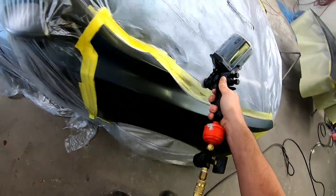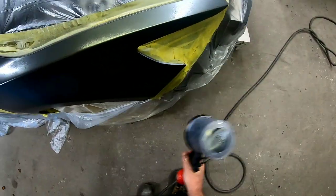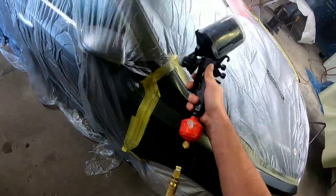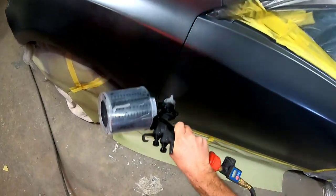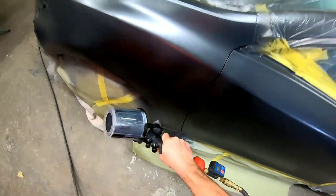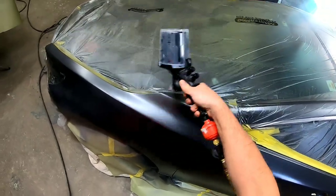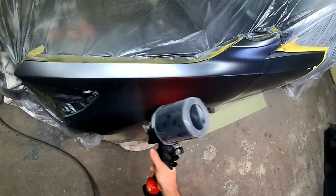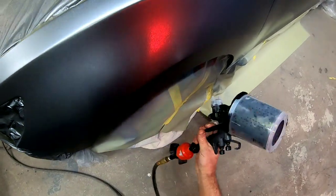Because we're replacing the hood, we need to blend into this fender. So I'm putting one coat of color across the top part of this fender, and I'm also going to do it at the bottom where the bumper meets the fender. I'll start the blend on the door by covering the first few inches of the door with color, and then we'll put a coat of paint over the entire fender. The paint I'm using today is the Nason XL, purchased at my local O'Reilly's, and I'm using the 3M Performance Gun to spray the base. When you're applying your first coat of base, you want a medium to wet coat of paint.